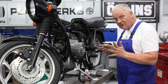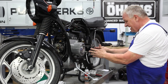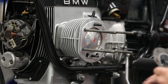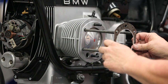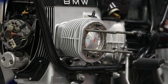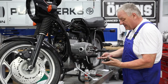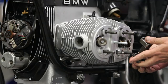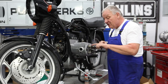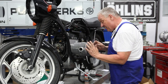These head gaskets can go on one of two ways — the right way and the wrong way. There's a smaller space on one side near the stud, and the gasket reflects that asymmetry, so pay attention when you're hurrying to beat the silicone. Verify that the holes perfectly line up. The pushrod tubes go in first, then the washers on this model, and then the rocker assembly. Note that there are little dots on the ends of the rocker shafts that need to be facing out. Now we're ready to start tightening bolts, a little bit at a time on each bolt as you draw it in. Make sure the pushrod is inside the socket of the adjuster.